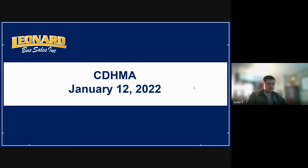This topic — EGR, DPF — we could talk for five hours about what's good and bad about it. I have a condensed version for the sake of time. Obviously we're talking electric, propane, gas — there's a reason we're having these conversations. Diesel engines are good, but they've changed because of EPA requirements. Twenty years ago, your bus yard would have a cloud of black smoke at startup. That's no longer the case because the DPF and EGR system is capturing all of that — it's still there, just being handled differently.